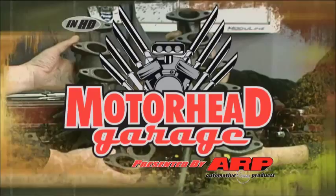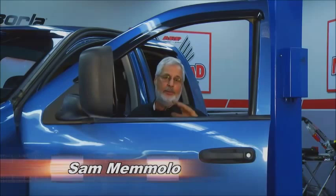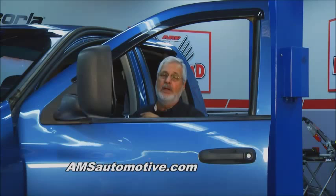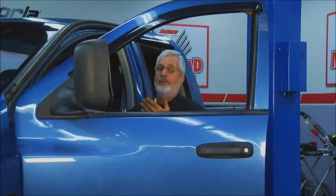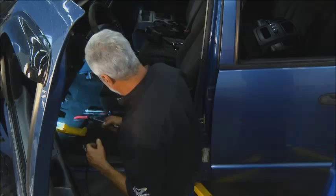We put in a nice clutch assembly and flywheel — we did everything right. One of the things these Dodges have is a hydraulic clutch. It's a slave cylinder on the side of the transmission — not one of those concentric ones on the release bearing. They work pretty hard and the factory ones weren't great. Particularly if you do an upgraded clutch, you want to change it out so you have good pedal feel. And if you change from a dual-mass clutch, there's a dimensional difference so you need longer stroke — they make a kit. The whole thing is the master cylinder, the line, and the slave cylinder. I'm going to start under here unbolting — it's pretty easy: two retaining bolts and a clevis pin on the clutch pedal.